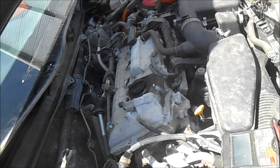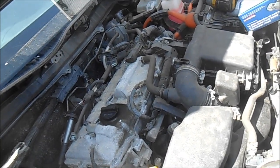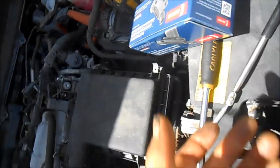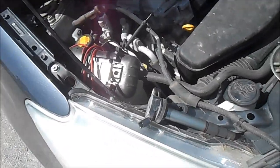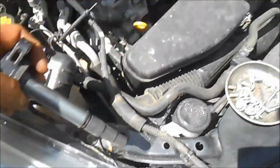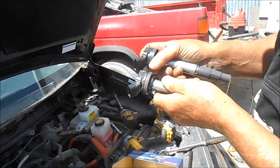But it kept saying multiple misfire even though the coil issue was there. So multiple misfire means the other spark plugs weren't firing. Sometimes the only code it'll kick is multiple misfire — you could have a bad coil. And if you have the fancy manual that tells you all the specs, you can check the wires on each coil. You never want to use anything but original parts or higher quality — never go with the inexpensive ones, ever. It's interesting on a Sequoia — the same size and everything. Yeah, it's a different number — 5444 — and this is a 5444. They are the same number.